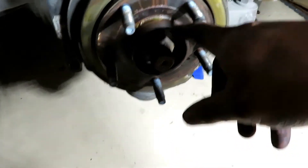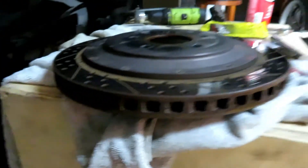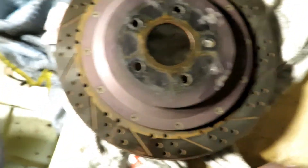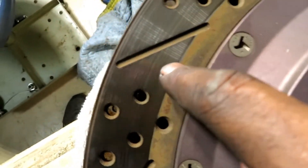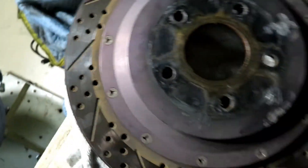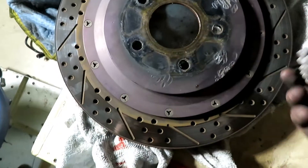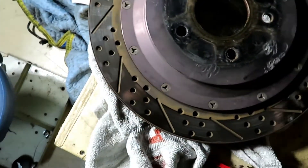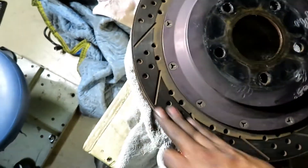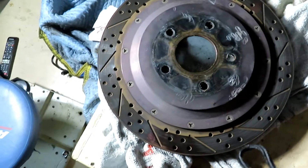After I put it on last time, I put a little ring of grease on here so it can come on and off easily. Now that the rotor is off, let me get my light going. You can see this has a mirror finish — you can see myself and the camera reflected in it. It's not supposed to have a mirror finish like that. I'm gonna use this flex hone tool for rotors that I got from Summit Racing — basically I'm going to make this shiny finish go away and put a bunch of swirls in it to deglaze it. Let me get the drill set up and work it around both sides.